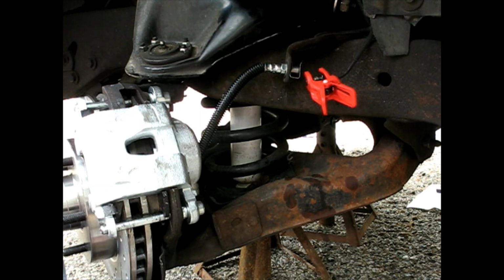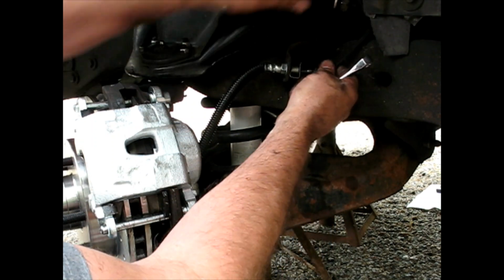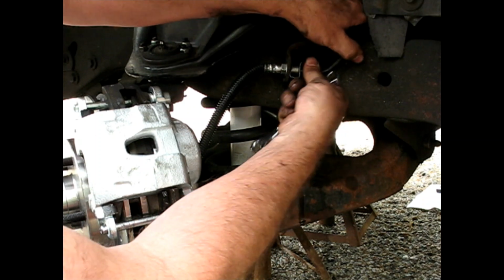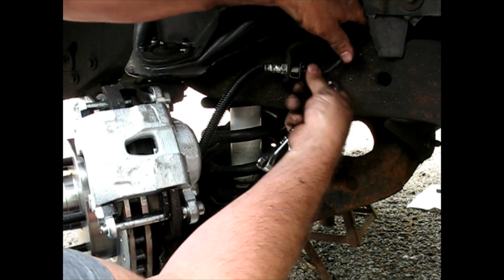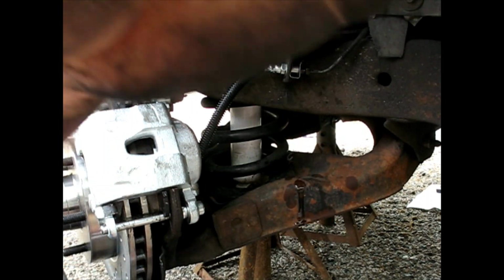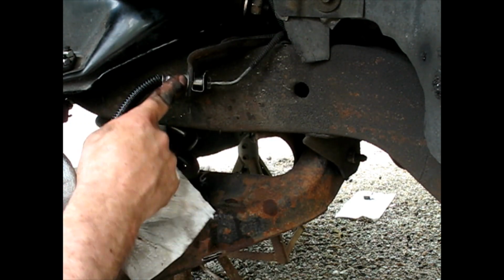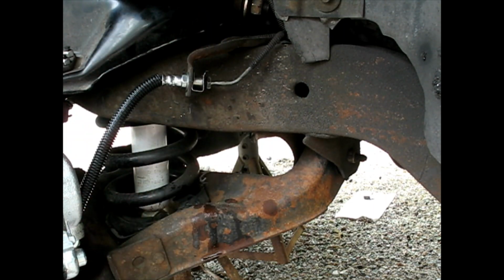Now we'll get out the right wrench for that guy, which I think was a 9/16, and hopefully get that in there without spilling too much. These never are fun to try to get lined back up. I'll bring you back when I get it. Got it. I just had to get in where you were, and that's the only way I could do it, is to move the camera. You have to get this washer all the way flat, and you have to turn that thing just right for it to pop in so you can get that clip on.